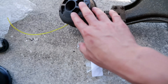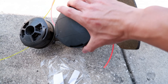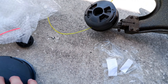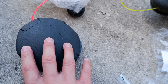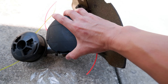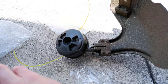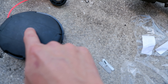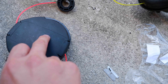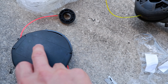What you can do to prevent that — this is a replacement one I bought and it's actually huge compared to the other one. This one is a speed feed, supposed to be a copy of the Echo speed feed 450 or 400. Look at the size difference between this and the one I bought before, which I also thought was an Echo copy but apparently it's a different model. This one's much bigger, but what you do is you just drill a hole here, put a screw and a washer through it, and it helps take most of that wear before it gets down to the metal and wears a hole where you don't want it.